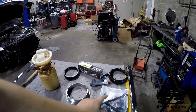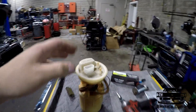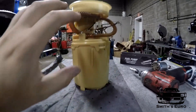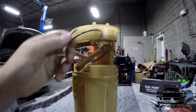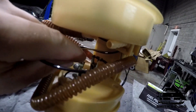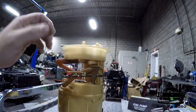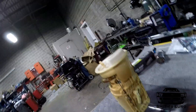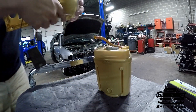I also have a couple of random hoses and the Walbro fuel pump kit — got all this stuff from Summit Racing, and the flange from Dumpy Bunny. I've already taken this apart but I'm just redoing it to show you. Cut the line off the fuel pump right here, pop that off — you should replace this hose too. Then you have two wires that go directly to the fuel pump with little tangs; just pull them up and they come right off. Flip to the back side and you have four 7mm screws — save those because they're special fuel-resistant screws.